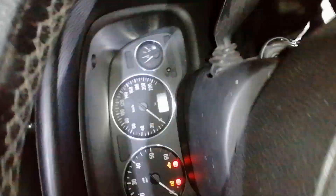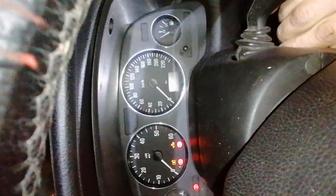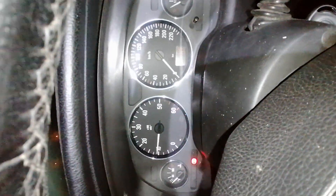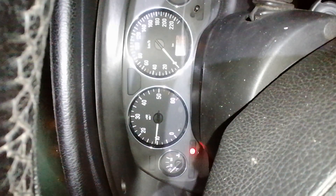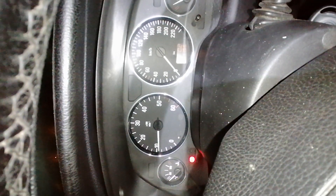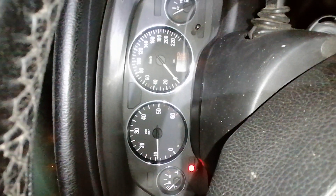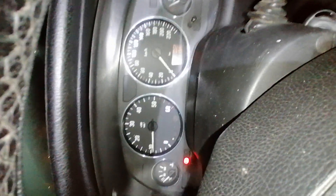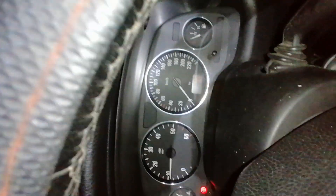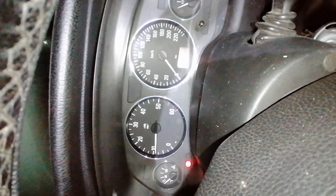I don't know if we have enough battery to start even once, but let's see — the moment of truth. The engine is on! So the problem was that solder joint that brings the power supply to the EDU board, the pump controller — injection pump controller. The car starts fine, even outside at around two degrees Celsius.